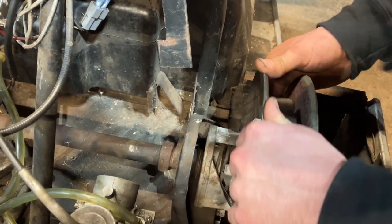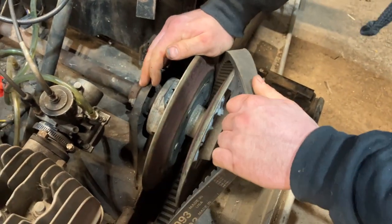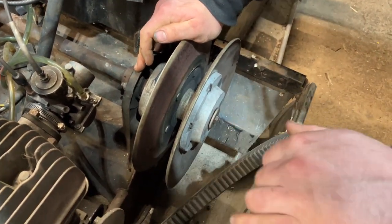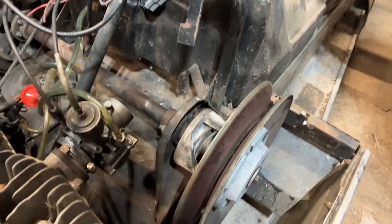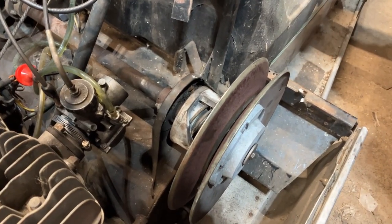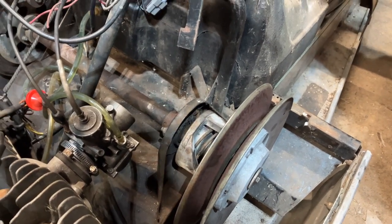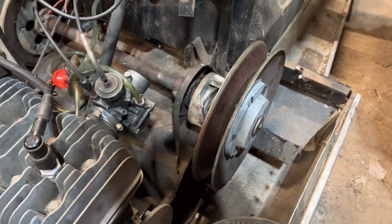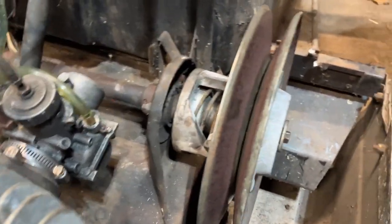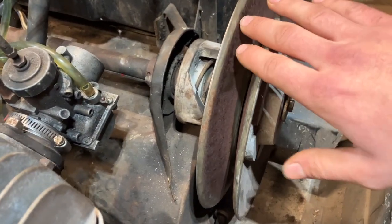You want to have someone hold the brake so the track doesn't turn, then give your clutch a spin so the belt can sink down. The rule of thumb is you can hear that snap. If it doesn't make that noise and snap like that, you either have really dirty clutch components or a broken spring. It should definitely snap back like that — if it does not, you could have really poor performance: bogging, poor shift-out, you name it. Definitely make sure you give it the old twist test.